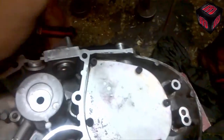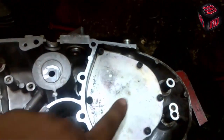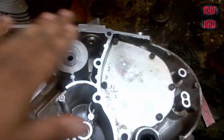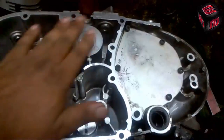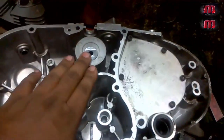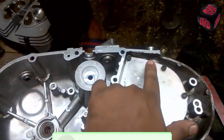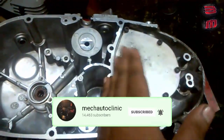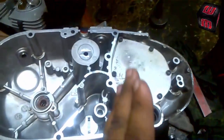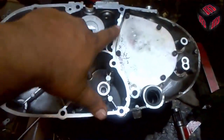This nipple is for to-and-fro purpose: air comes in, air comes out. When air comes in there is no oil, but when the engine rotates and hydraulic pressure increases — when gas is generated because of heat — the air tries to go out with the oil. The breather box separates the oil, keeps it on the down side, and only air goes towards the filter. This is the tracking system of the crank breather.